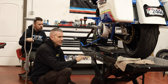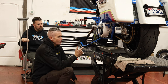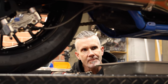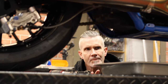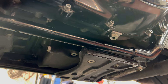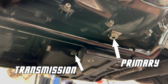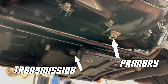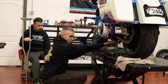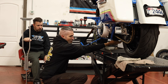We've got our motorcycle on the lift. I've done a hot oil, so I've run the motorcycle up to operating temperature and put it on the rack. Now we're ready to drop fluids. On the M8, we've got three drain plugs and they're all on the left side of the motorcycle. We've got the primary right here underneath, then the transmission is right here on the left side, and the engine oil will be up to the front. A little nuance with the Twin Cams — the transmission plug will be over on the right-hand side.